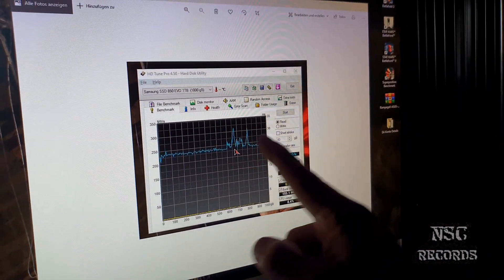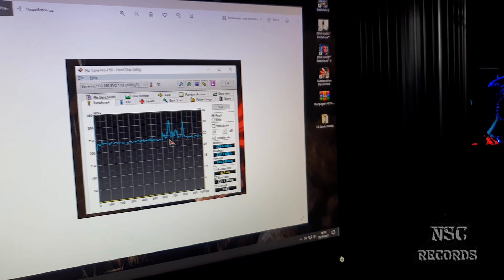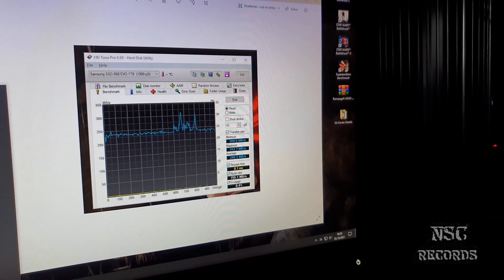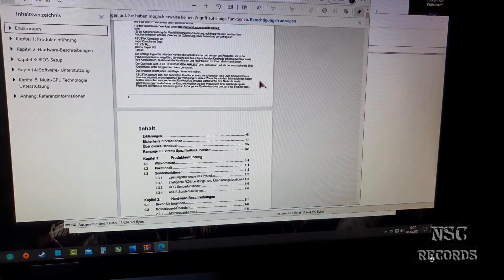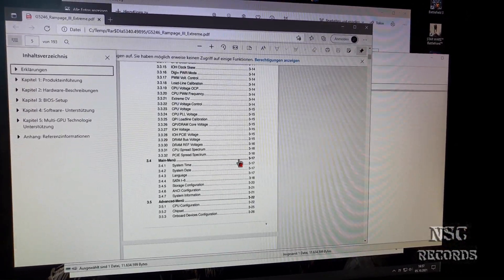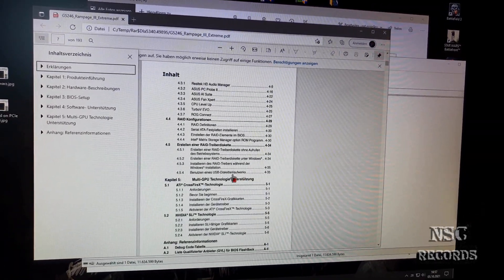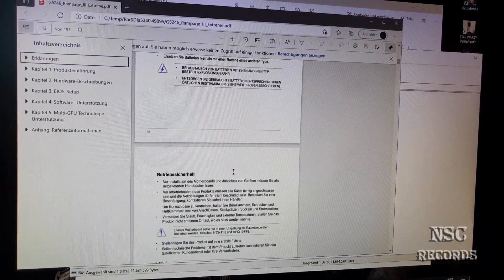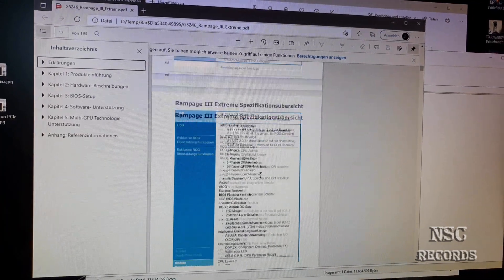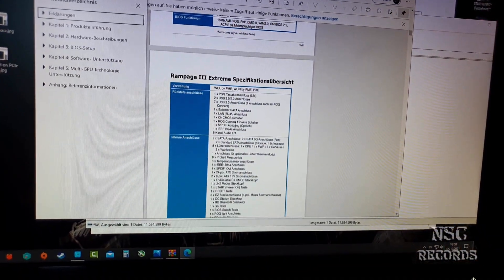The SATA card is working faster because it's connected on PCI Express 2.0 instead of the older standard slot. I recommend you try to get the manuals from the internet — if you have an ASUS motherboard go to the ASUS webpage, if you have ASRock or Gigabyte it doesn't matter, just find the manual. I found out I still have PCI Express 2.0 and I always thought I had 3.0 — that's why I thought my card wasn't great.